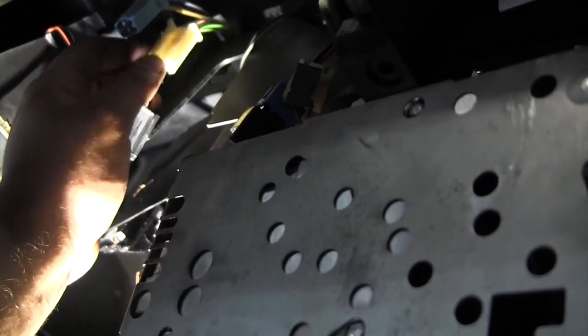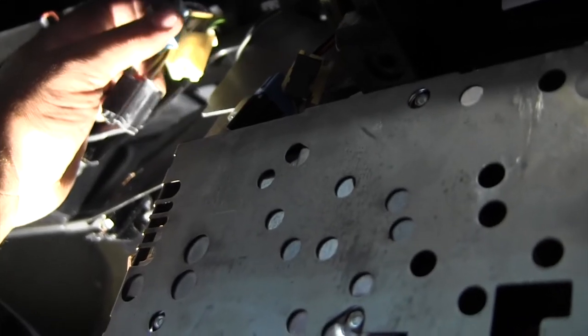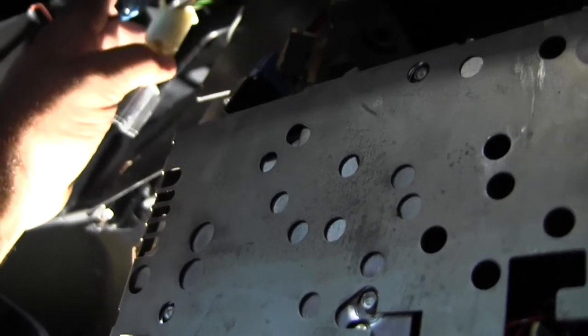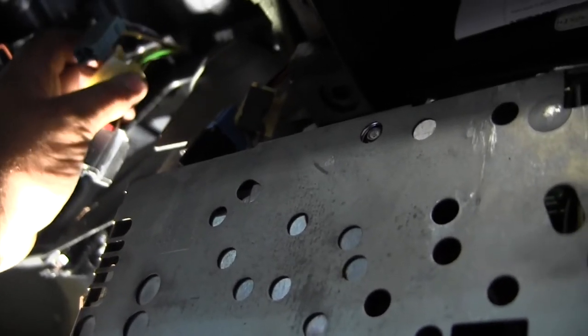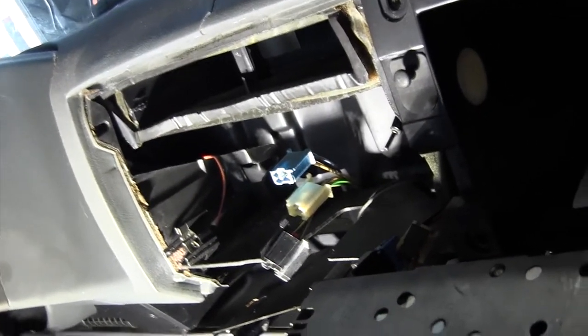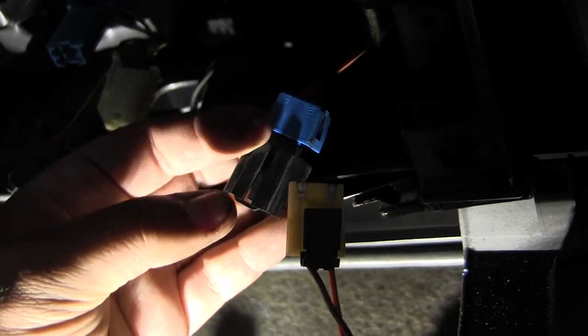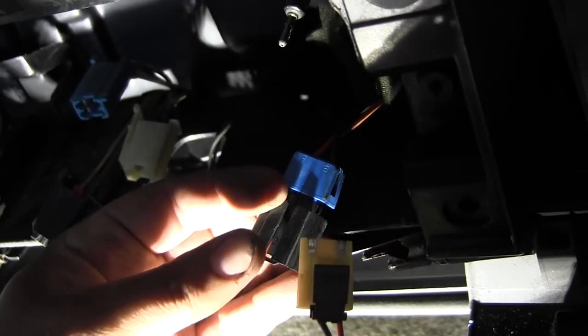If you could push up on the connector, go ahead. And it should release. And then do the top one, then do the middle one. Because the shorter it is, the more likely pulling on the radio is gonna pull it out. So just do middle, top, and the bottom. And that's what I did to get it out. This one right here, it's kind of a pain. I just used a screwdriver to split between the white and the black part, and it came right off. Just pull on the release tab, this black release tab right here. Okay, lighting's really bad, but I just got a screwdriver underneath here, popped it up, and it came right off.